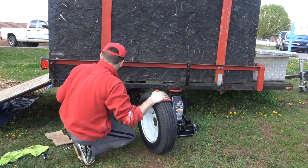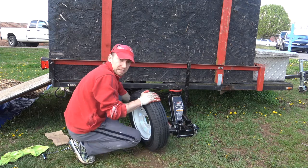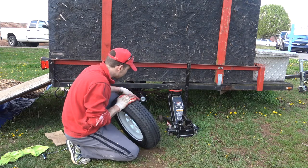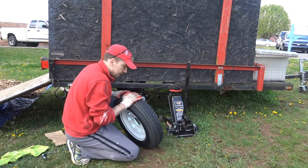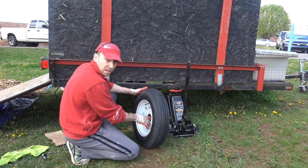So the first thing we've got to do is make sure your jack is set and there's high enough clearance. Some trailers have the hubs on the outside, which is easier — this one is on the inside. Make sure the hub is all done and clean. You have your tire, and be careful because it's a pretty heavy tire. You're going to lift it up and try to balance it on all five lugs.